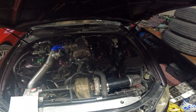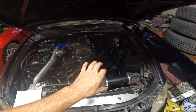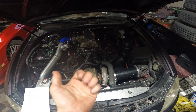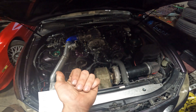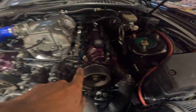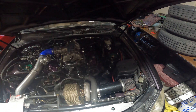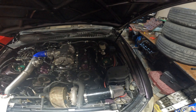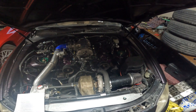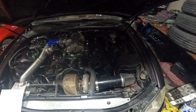That's everything I had to buy for the turbo itself, but I was already on a standalone ECU with bigger injectors and a bigger fuel pump. For a quick rundown: I have a Walbro fuel pump — you're going to need a bigger fuel pump. I'm on a standalone ECU so I can run whatever injectors I want. I'm running Subaru 565cc injectors — they are drop-in; you just shorten the fuel rail spacers by about half and they plop in with the same connector. I'm also running coil-on-plug; if you're on the stock ECU you won't be doing that.